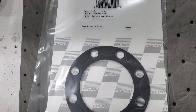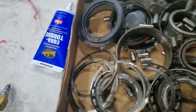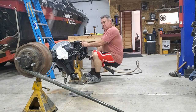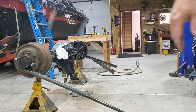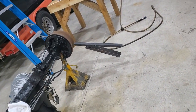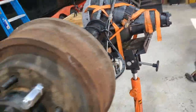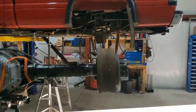Pattern reading — I wasn't setting it up or doing anything crazy, I just want to see what she's going to look like. We are using a used gear so we're kind of stuck with what we got. Hopefully it's good because I don't want to do all this over again. Somebody from the factory did a good job — right in the middle. I don't think you can ask for anything better than that. I'm going to run with that. Seal installed with some grease on the inside of the lip, a tablespoon of ultra black inside the splines, and then RTV here so the oil doesn't get past the splines. Rearranging those clutch discs made a huge difference.